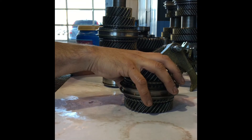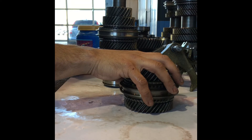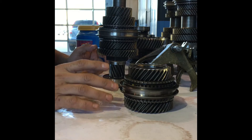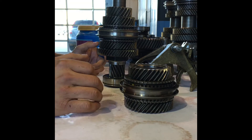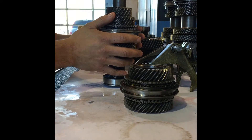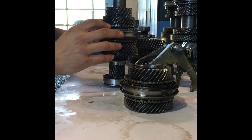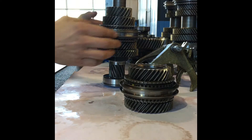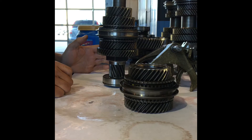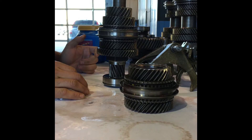We're focusing on third gear specifically, since third gear is usually the hardest gear and takes the most pressure when you're racing your transmission. You want to inspect it slowly and carefully so you don't miss anything and don't have to go in and do it twice. This is a perfectly good T850 input shaft already assembled. I'm still going to disassemble it and inspect the blocker rings to make sure everything is the way it's supposed to be. Majority of the time you can inspect it by eye.